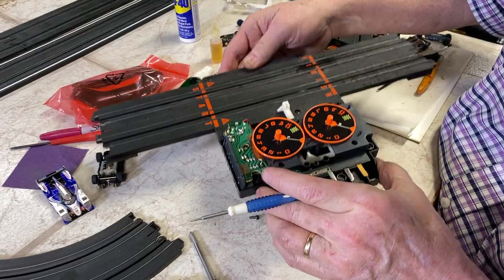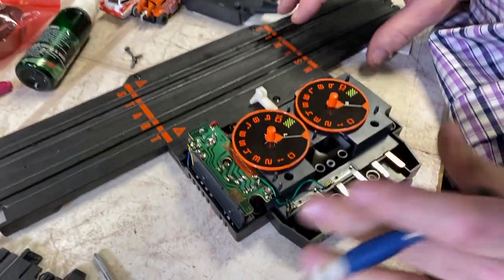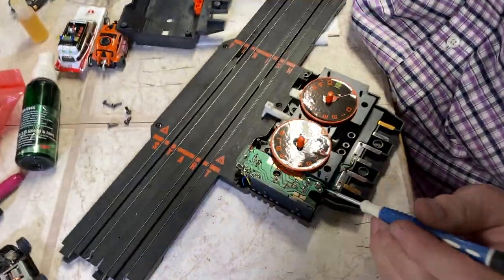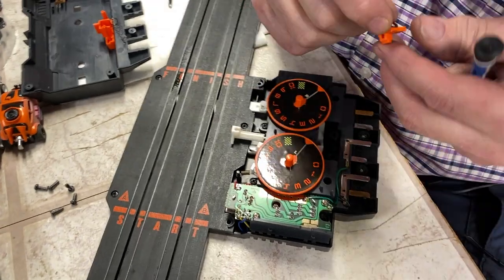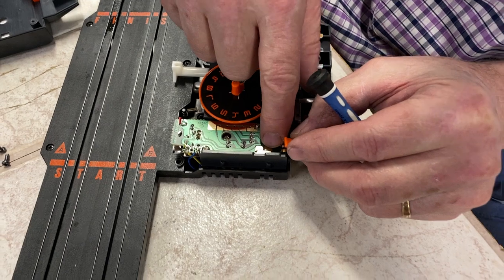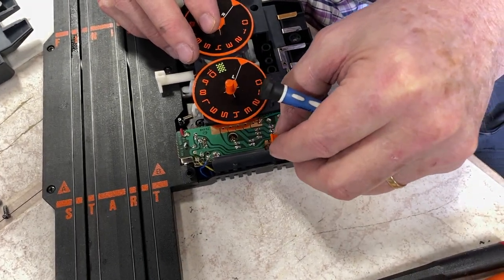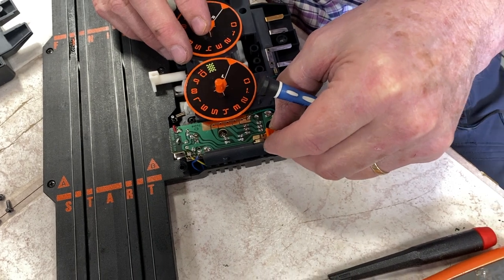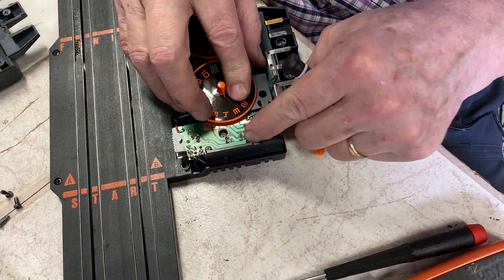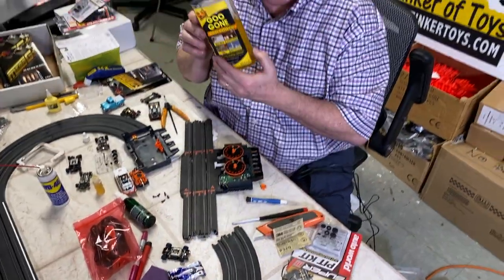Let's shake those screws off. So this is the inside. These two little brushes here, this is what's sliding across. This one is the circuit for manual, and that one is for auto. So when you slide it, it's going to connect there or it's going to connect here. And this is what might need to be cleaned off.